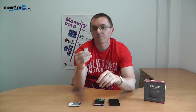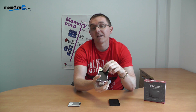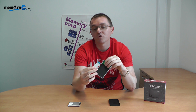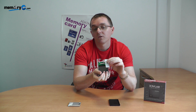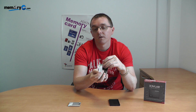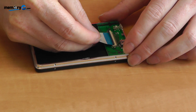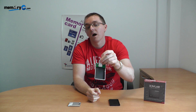I now want to show you the blue end going into the actual enclosure itself. If you notice the lever on that — up and down position — it's actually very loose, but the thickness of the back of the cable is sufficient enough that once you place it inside, you'll have a strong tight seal. Do not do it this way, because the contacts are not touching the actual board itself. So you lift up the lever, take the actual blue backing, place it directly in. When I push down the lever, making full seal and full contact — I can do this, but I highly encourage you not to, as you risk damage to your cable. I'm doing this to illustrate the strength of the actual connection.